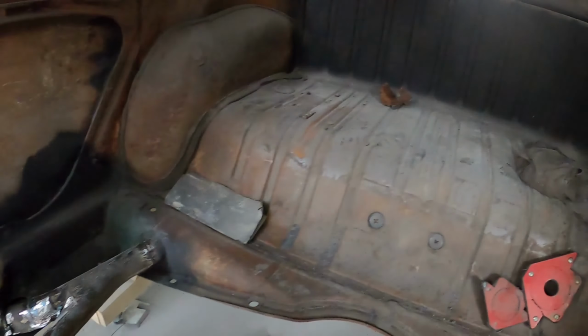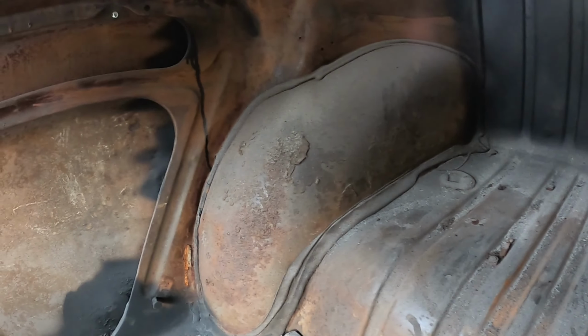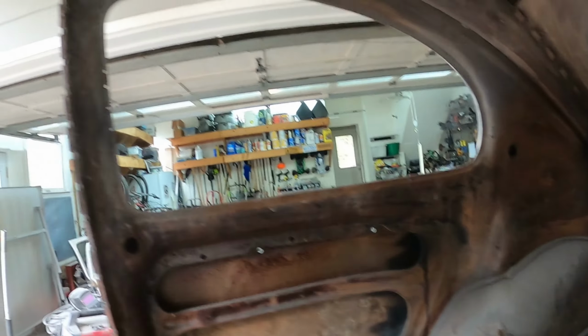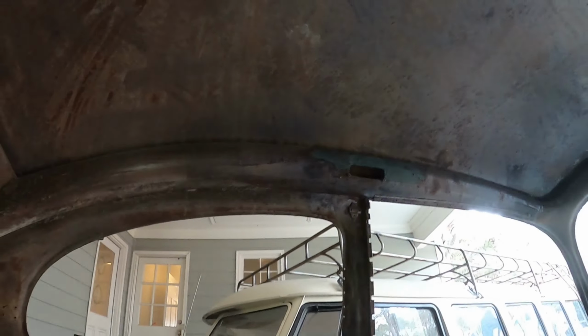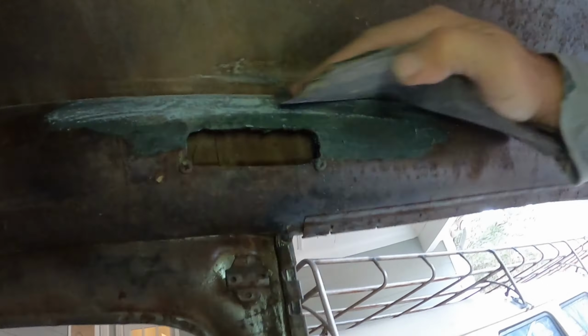so that I can paint. I'm gonna paint the entire interior, to wind up basically getting rust reformer, because look at what I've got on here. I've got some rust. I need to clean that off, wire brush it, rust reformer, and then that'll act as my primer as well. And then I'll probably put some of the white primer on top of the rust reformer. And then after I get the white primer on there, I'll put the Lotus White on. Look here. This is where I did.